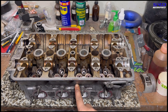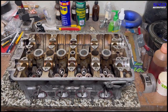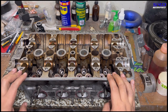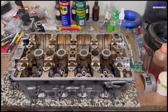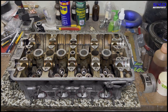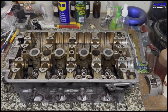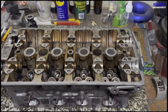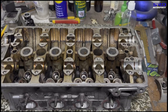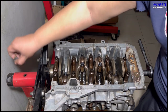Under normal driving the oil level in the head is fine, but when you push through first, second, third, even fourth gear up to 9,000 RPM, the head can become overfilled and oil can't drain. This is because crankcase pressure from the block tries to escape upward through the valve cover breather, blocking proper oil drainage. That's why a valve cover breather alone isn't sufficient — you need a breather on the block itself.